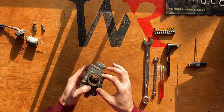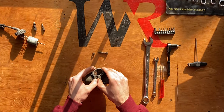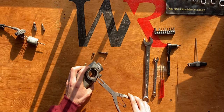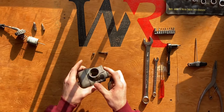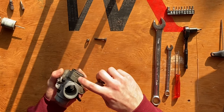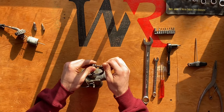Next I want to remove this clamp, which clamps the carburetor onto the cylinder of the BMW R60. I'll remove the bolt first — there's a nut on one side. I grabbed some snap ring pliers or C-clip pliers to expand and take this off. This is the collar for the carburetor; you want to make sure it's not too damaged and that the cutouts where it clamps onto the cylinder are still in good condition so the clamp functions properly.